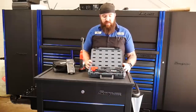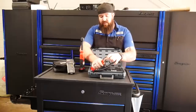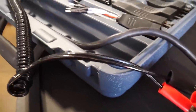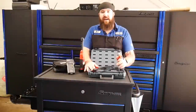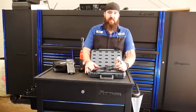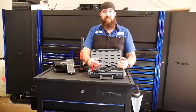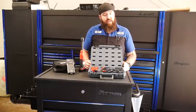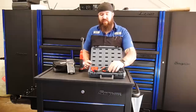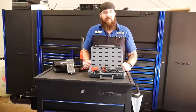This kit has been awesome in being able to test certain vehicles this last week. The only downside I'm seeing so far is the battery cable setup is only about a foot and a half long — it does accordion out to a couple of feet, but I think if they would have had another three-foot lead on this it really would have helped. Not every time is your battery right next to the PDC where you're testing. So if that doesn't work, you've got to have some kind of jumper leads to the vehicle's battery or ground area, or use a positive lead on your PDC housing output to a chassis ground. I would give this one about a four out of five stars. It's helped tremendously in finding the circuits, but because of the lead issue you kind of got to lose a little on that one. Other than that, really great tool — it's definitely staying in my toolbox.